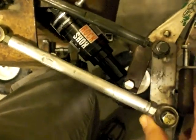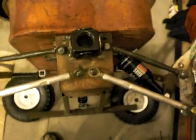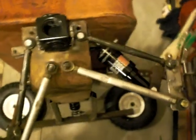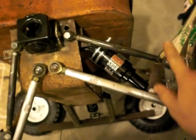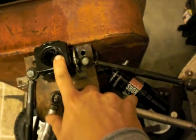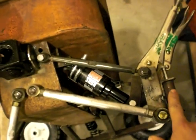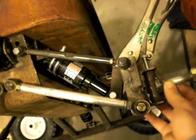It's no longer going to hit the bottom of the wagon. Because I did this, I lost quite a bit of travel — right about there is going to be fully extended. One of the benefits is I'm going to have a significantly less amount of scrub. Also, this area of travel is now only about three inches where it was about five before, which allows the distance from the steering arm to where my steering knuckle will be on my spindle to remain constant.